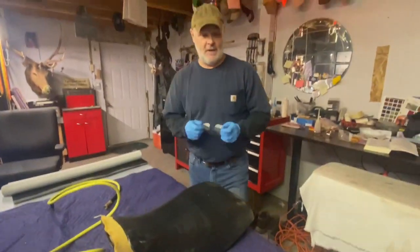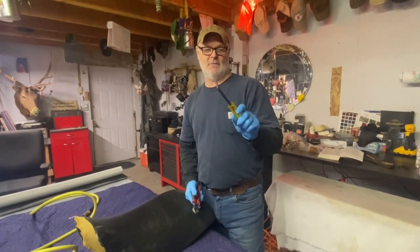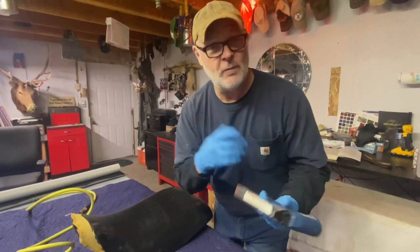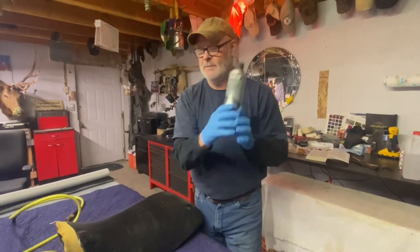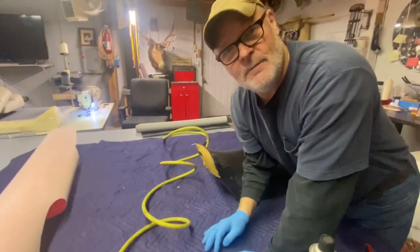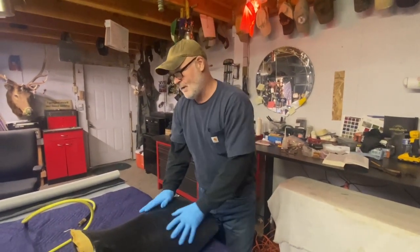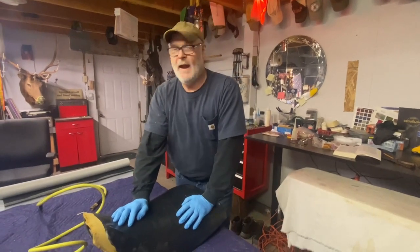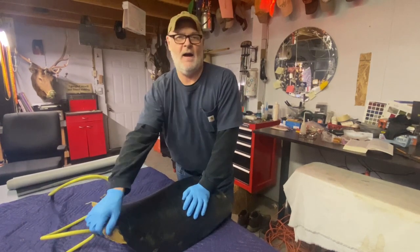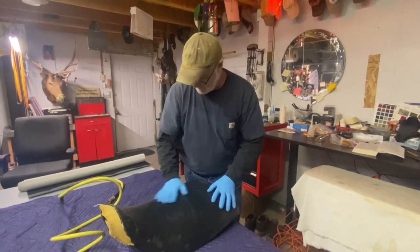So these are the things that you'll need. You'll need the old trusty, rusty Osborne staple puller, a pair of dykes, a nice BS staple gun or whatever you have, a can of foam lock, and some scrim, quarter inch scrim. I like to use scrim, as you all know. Or you can just use foam if that's all you've got. I wouldn't recommend putting half inch on. It's just too high of a profile, unless there's damage, but it feels like this is fine.